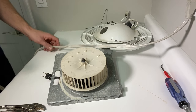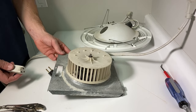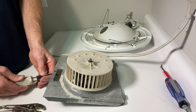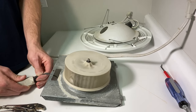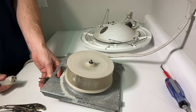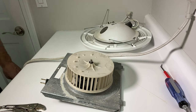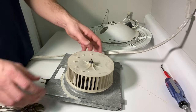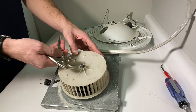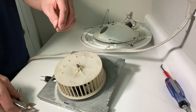Now I have the motor assembly on the workbench. With it plugged into an extension cord — and obviously be careful here because the fan blades are open — I want to confirm if the same issue is present. We can hear that ticking: some type of interference where the flat fan blades are contacting the bracket for the fan motor assembly.